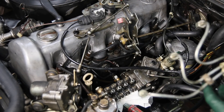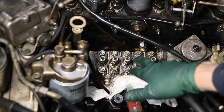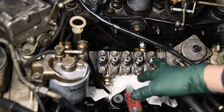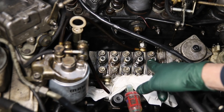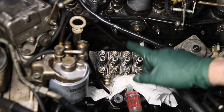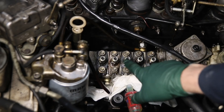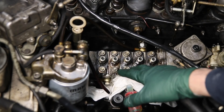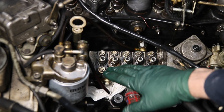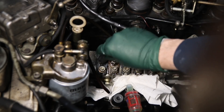Now there's one more very important thing you need to do before you start your work on the engine. You can see how exposed the tops of these delivery valves are once I remove the hard lines. You do not want to get any dirt down in here — you're going to have a problem. You can even damage a fuel injector if you happen to drop some dirt down in here and it gets up into the line. So before I start working on the engine or removing the injectors, I am going to put protectors over these. If you don't have these you could use a shop towel, but I like to use silicone caps because then no lint can get into these either. I'm just going to put a silicone cap over each one of these delivery valves.